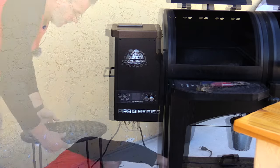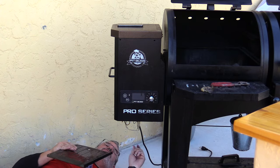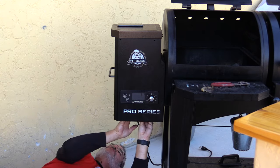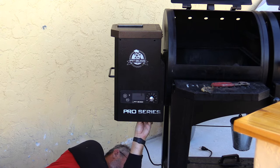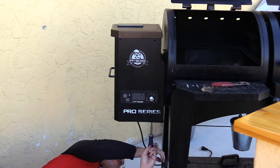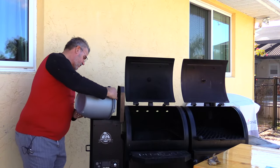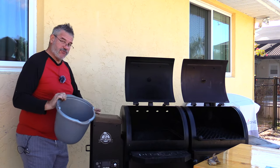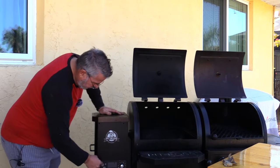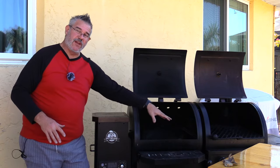Our firebox is good and attached again. Now it's just a matter of putting your grate back up. By the way, the first time you do this, these wires are all tie-wrapped underneath — I don't bother with that, just make sure they're not at risk of going up into either of the fans, and in this case they are not. I like to get two screws hand-tightened first so I don't have to hold it in place. With everything put back together, it's time to pour our pellets in — I had pulled them out before I took this apart so they wouldn't spill. Let me go ahead and power it on.